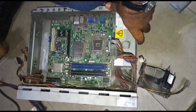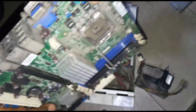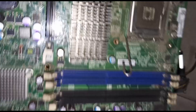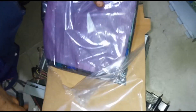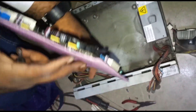When handling this kind of PC you have to be very careful not to damage your board. This is the old board - it's dead and not working. If you power on the machine it won't show any light but the fan and everything inside will come up. Now, if it's a processor issue, the machine might show light but will be on a constant blue screen or not able to load. Hard disk issues are different - when your machine is trying to boot with a hard disk issue, you will see errors like 'Operating System Not Found' or other boot errors.